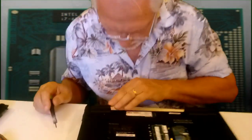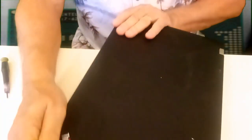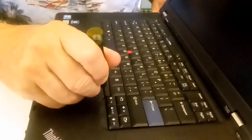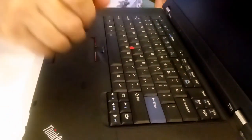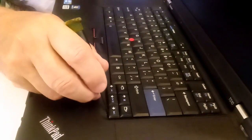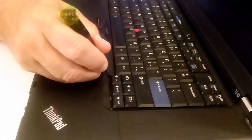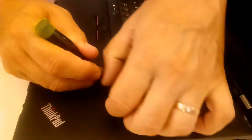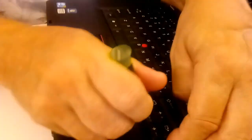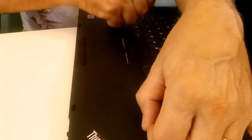And it looks like we have it here. We'll give it another try. See if that keyboard's going to come loose on us. These keyboards are very, very tight. Lenovo has very tight standards on this, but I get a little more movement. Let's get a smaller screwdriver. And there's a metal frame around here. You don't want to go on the keys, but they're inside there, just to the outside, so you can get a little movement. And hold it up. And try this side here.